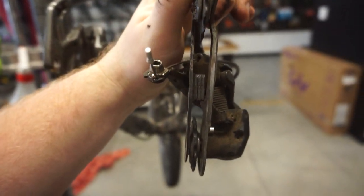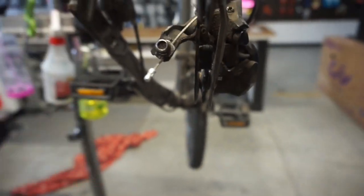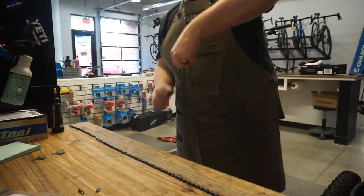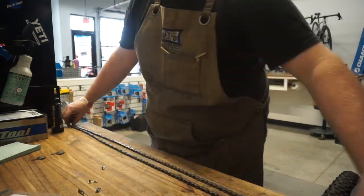What I'm showing you here is a guard for this derailleur — it doesn't allow stuff to go through there. They routed this chain under there and it created a path, basically rubbing the whole time. That is not something you want to do.